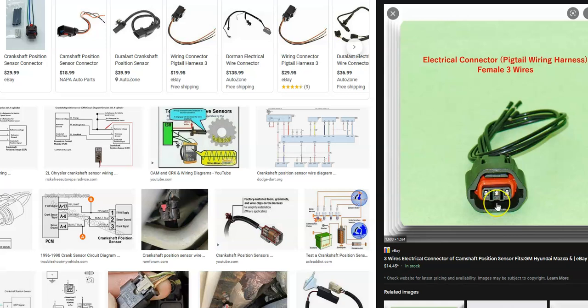With the three-wire setup, the middle pin will be ground. One of the outer pins will have a reference voltage that's always on — it comes from the battery, so when the key is turned to the on position, that outer pin will have voltage to power the plug, usually 12 volts but it could also be 5 or 8 volts. The other wire goes back to the onboard computer to report what's going on.